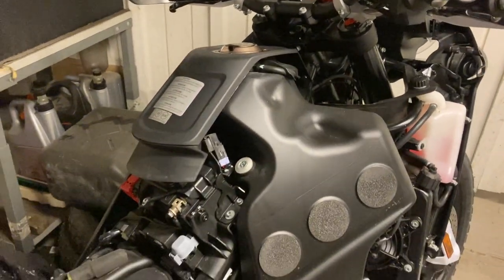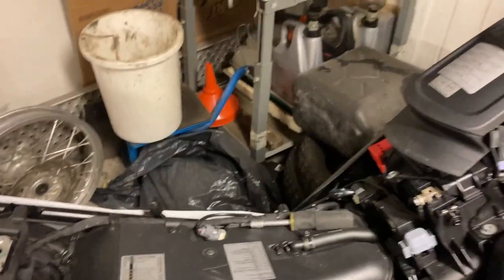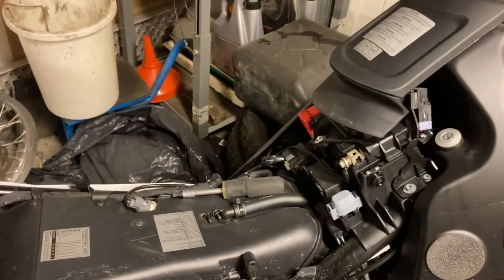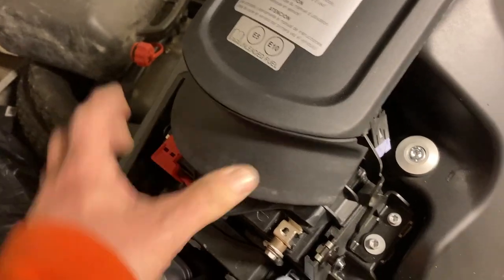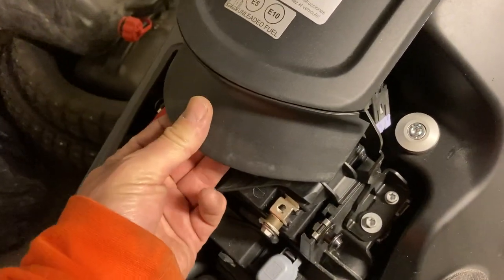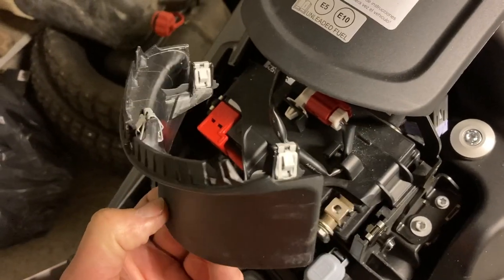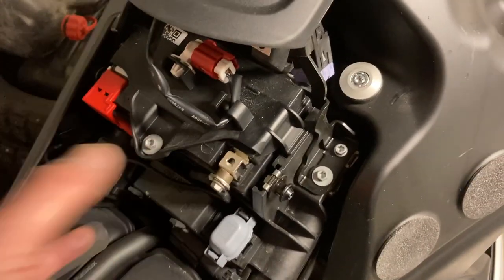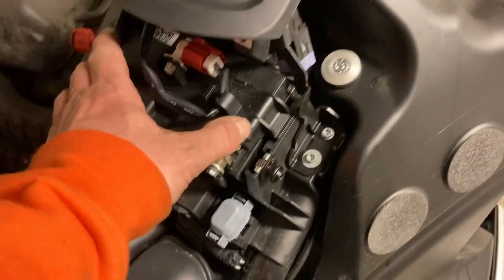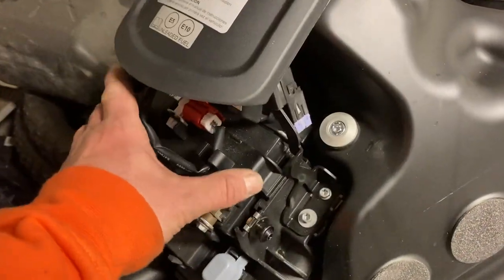Then I was curious how to remove the side cover and I want to show you that. You see the right one is already off. It's very easy — I didn't have a manual or anything, I just tried it carefully. Just be careful not to break anything. So the two seats need to come off of course. Then the battery cover here, which normally has two screws on a 790 and 890, is very easy — just pulled off. It comes out like that. It has these three metal clamps that hold it in place and you have already access to the battery in case you want to take it out, for example, or disconnect it over winter. Very easy. Unfortunately here on the bike the battery is quite high, so it will raise the center of gravity a little bit, but at least it's easy to access.